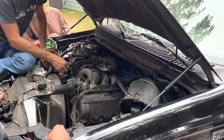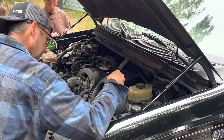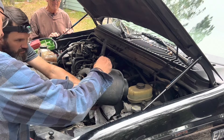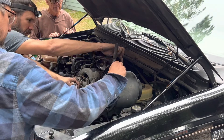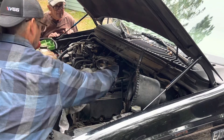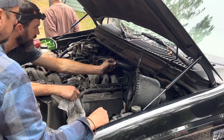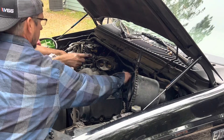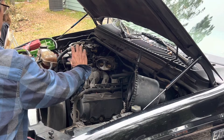Now we're just going to put the hose back. Do you have a mass air flow cleaner? I think I just used that. Can we wipe that out of here? No, that's all sealed. I think that's okay. I was worried about it, but it's dry. Maybe I didn't spray it into there — maybe I actually put it on the backside and it sucked it that way, and the residual ran out because it's downhill. That's exactly what I did — it just ran in and smelled. Now that you mentioned it, I put it in here from the brakes — yeah, that's a good idea. That makes more sense, because it's constant vacuum. Where this one, you only have good vacuum if the butterflies are open.